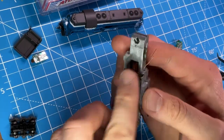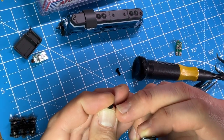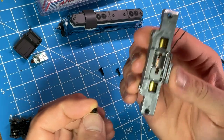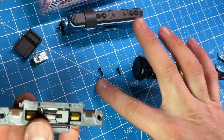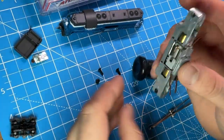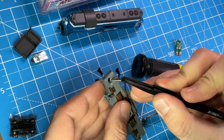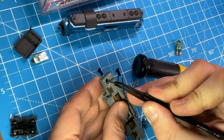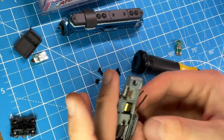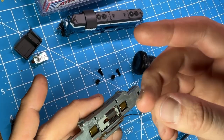On the backside, you see the little donut here? One fell out of the hole — it's just a little hex donut with a bevel. One edge has a flare and the front edge has a little round edge to it. Make sure you're putting it back in the right way when you stick it back in the frame half. Your two screws are going to fall out — that's fine, work on a table. To remove the second donut, just give it a little poke with a thin instrument right through the middle and just the tiniest little bit of pry. Motor polarity: white mark down — it's only on one side, so remember that.